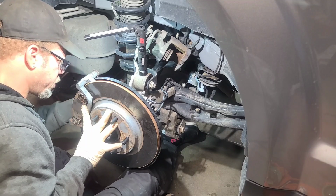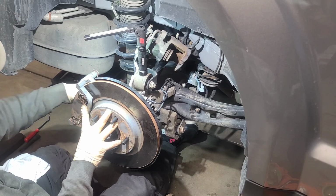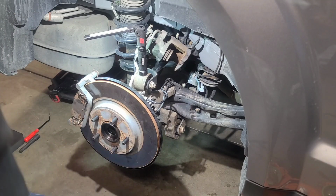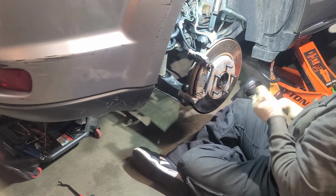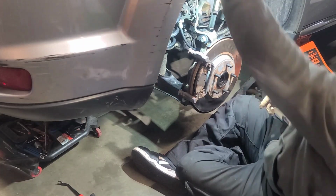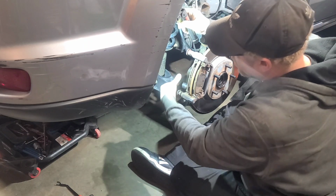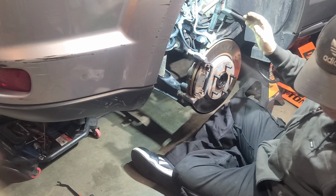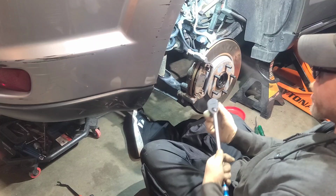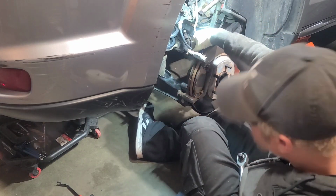All right, one at the bottom. And we're going. And these are your 18s for your bracket. So let me move the camera to this side so you guys can see. All right. And make sure I got my 18, that's the 16, and my 18's up here. Tighten again. And you could use a torque wrench, but I took them off with a breaker bar, just tighten a little bit. Breaker bar loose, click, going tight. And move my 18 down here.